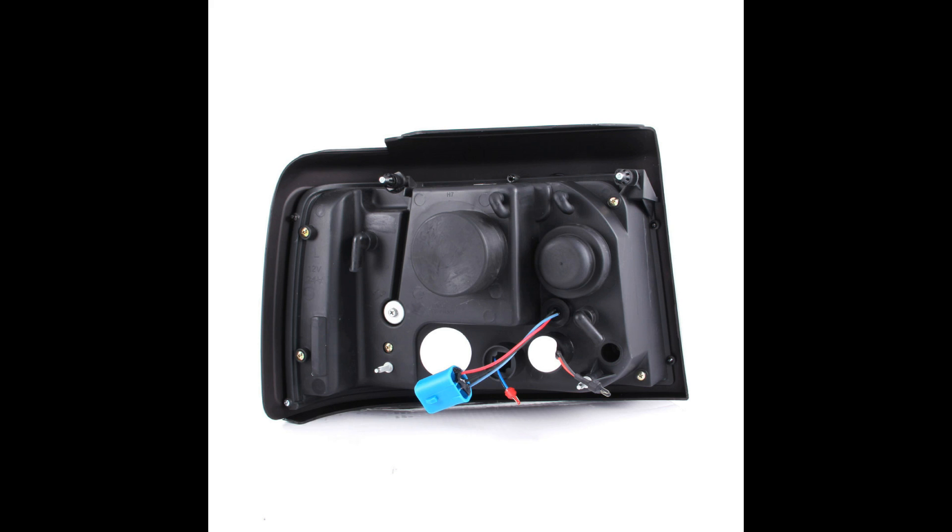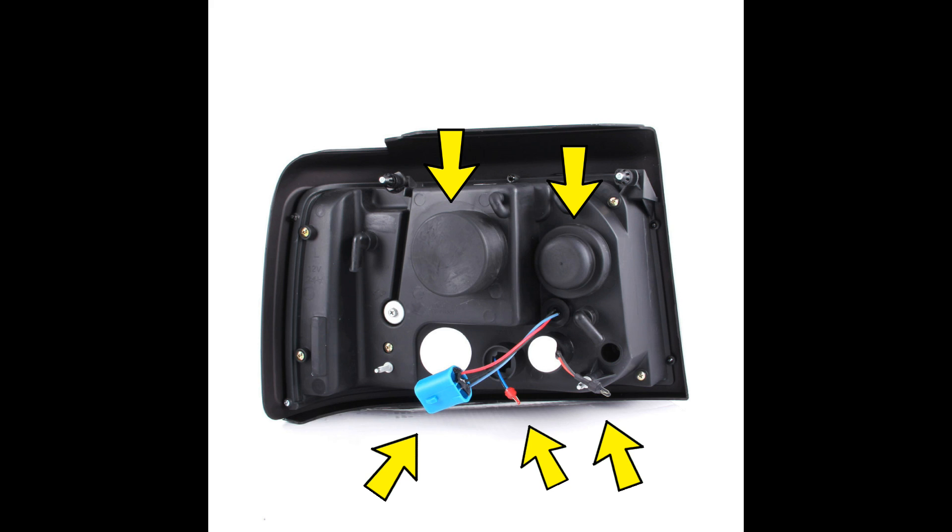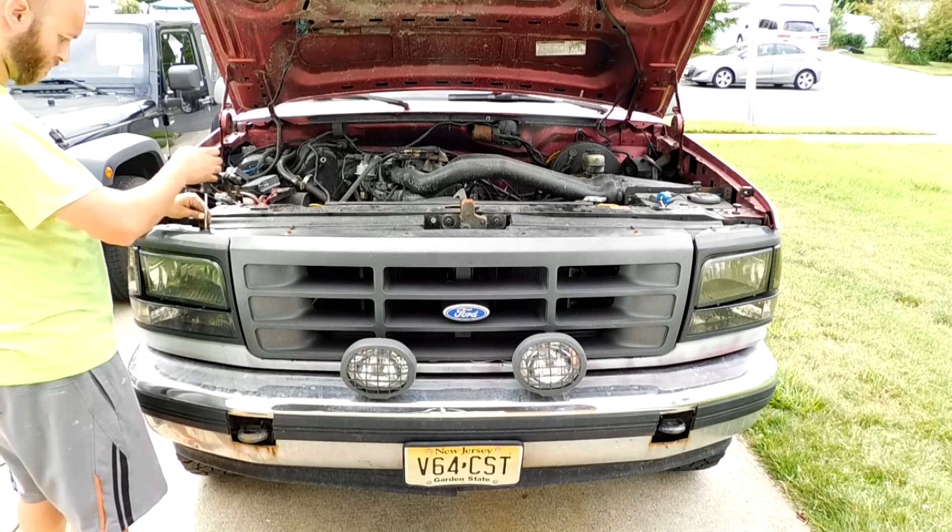Here's the rear view of this new one-piece design, and it attaches to the truck in the same exact points that the stock setup does, so there's no modification needed. There are covers for the bulbs and this comes including bulbs. There are only three wire hookups — one for the headlights and two others for everything else. Those last two wire hookups are potentially the most confusing part of this install, but all you do is remove the bulb from the stock harness and slip these connectors into the bulb socket. They're designed to simply replace the bulb with all wiring already included, so the LEDs activate when the normal bulbs would have.